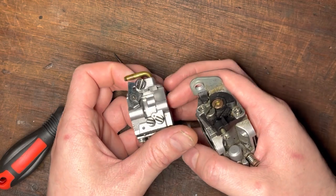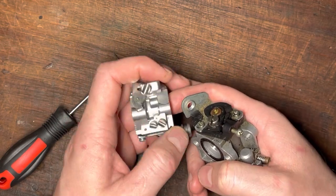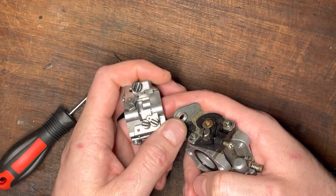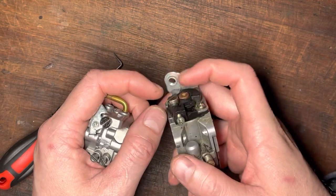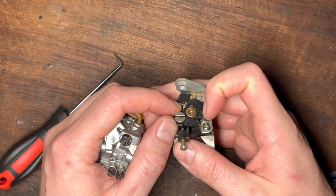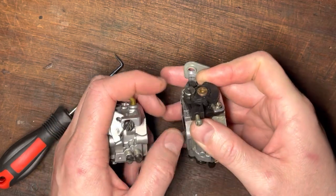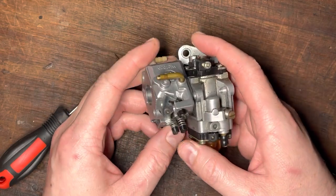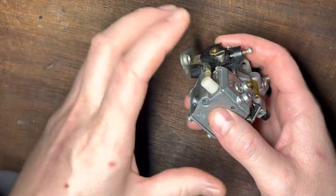When you turn your engine on its side, you might find the engine dips in RPM. Lots of people say that means the crank seals have gone, but that's actually not a valid test for crank seals — it shows very little, if anything. If you want to test crank seals, the best way is a pressure and vacuum test — specifically a vacuum test.